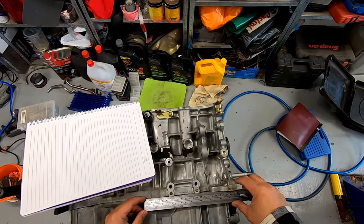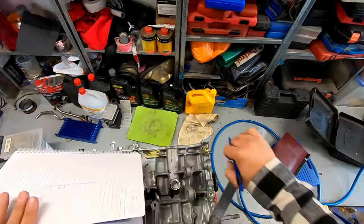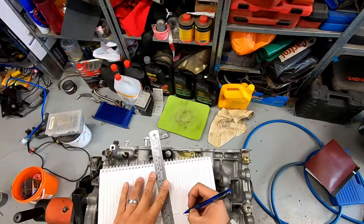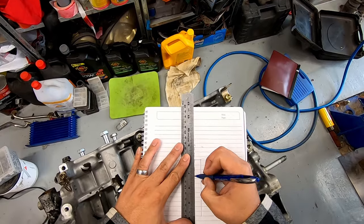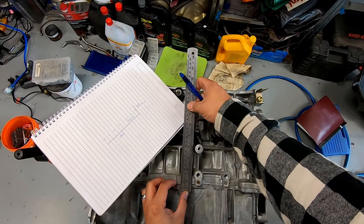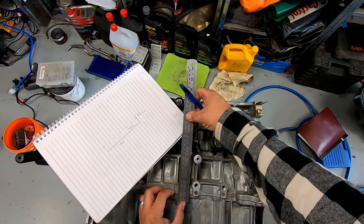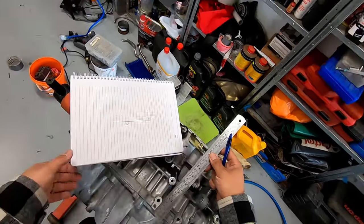For the 2AZ on the driver's side, we're picking up the three holes and alignment dowels that originally held the driveshaft bracket. On the passenger side, there are two untapped holes halfway up the block and one hole on the upper sub skirt. Once we've tapped these with the M12x1.25 tap, all we need is some spacers to create a flat plane where we can bolt up a large plate for our passenger side engine mount.